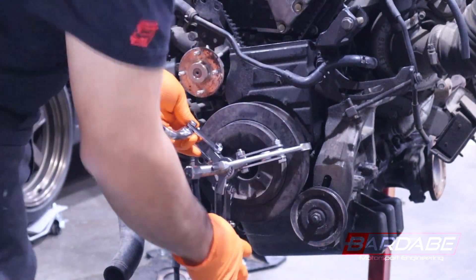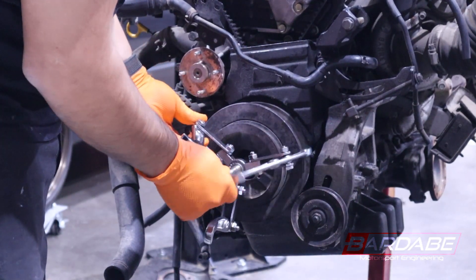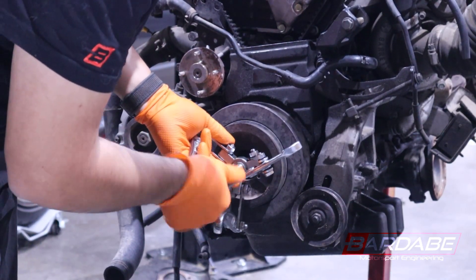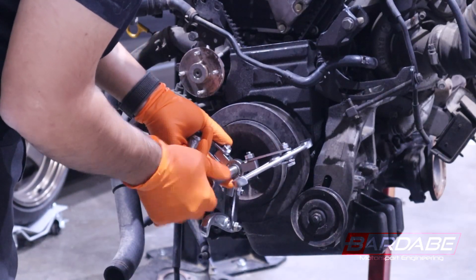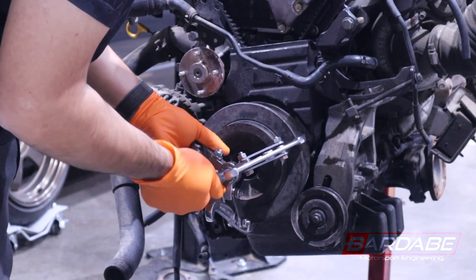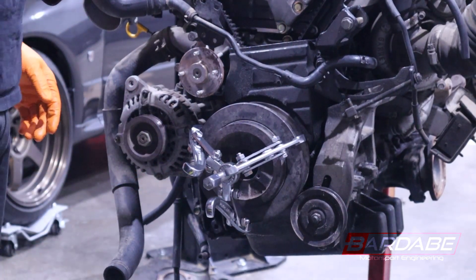In this example, I'm showing you a three-jaw puller, which is not the best way to do it. It's known for marring the front face of the crankshaft with the cone. It also tends to pull on the edges of the damper, bending and damaging it and having other ill effects. These tools should not be used to remove harmonic balancers from your engine.